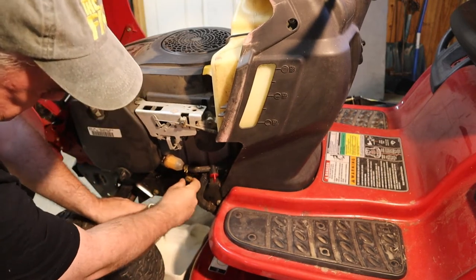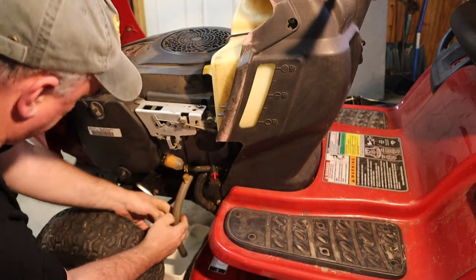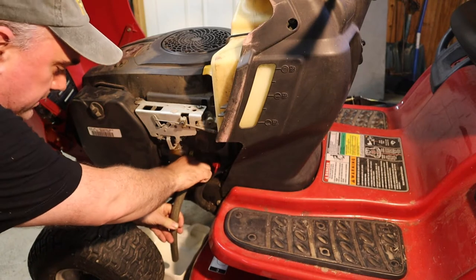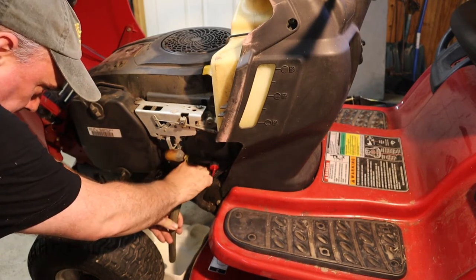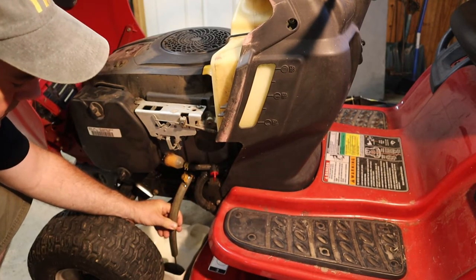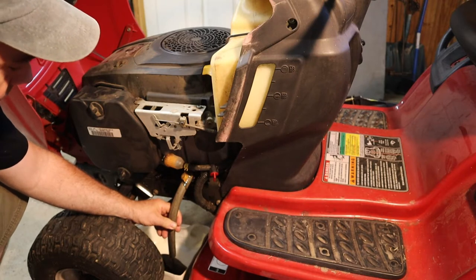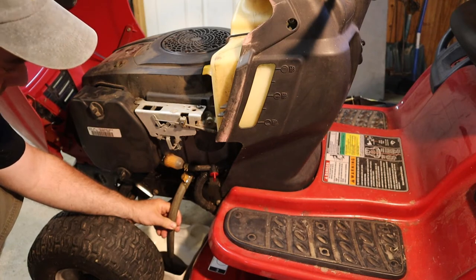So let's open this up, take the cap off, and put the piece of garden hose on. You need to turn this and pull it out — and now the oil is draining out. I did run the engine for a few minutes so that the oil would be warm and stir up the dirt in the bottom of the oil pan.